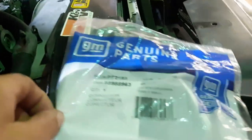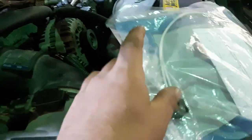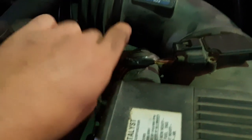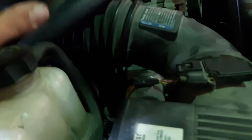That's kind of odd because I could barely make it up the driveway when I brought it in. Anyway, I'm going to change this pigtail. I got this on Amazon but it's a legit GM part — comes with a big long lead on it. The thing that sucks is number one is way down in here behind the fuel injection control module, so I have to pull the airbox out just to even get in there.